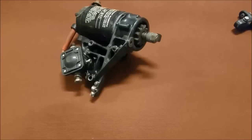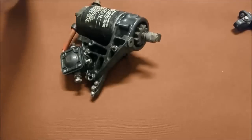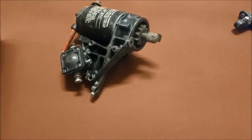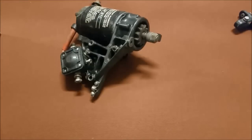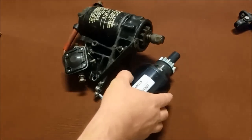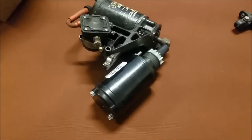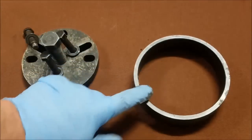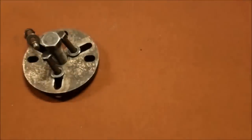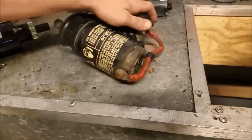As if I didn't have enough money into this already, we're also going to need a new starter, because the one currently installed in this bracket is no good. Here's a new in-box Evinrude starter. That's most of it — we'll still need battery cables, a couple of clamps, zip ties, fuel lines, fuel fittings, and miscellaneous little but expensive items. For tools, we'll need the Evinrude puller, and this is a coil alignment ring. All right, before we go too far along, let's change the starter out.